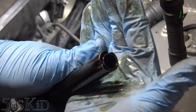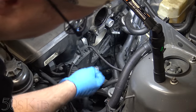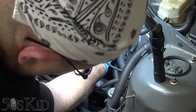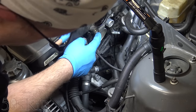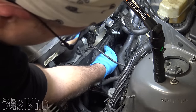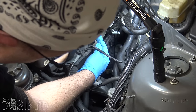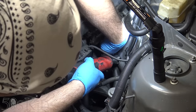Our next step is to remove this electronics box. There are three bolts — they're all 10mm. There's one here, one here, and one up here on the far lower side of the throttle body. Now, there are going to be two bolts down here: one is just a normal bolt, and what we're looking for is a nut. If you feel down there, the normal bolt won't have a little stud protruding from it, but the nut does. Feel around down there — you'll feel where the stud is and then just above it where the bolt is. The bolt is for the throttle body; the stud with the nut is for this electronics box.